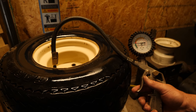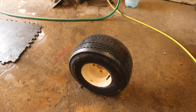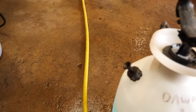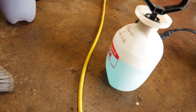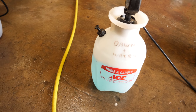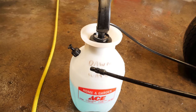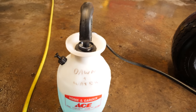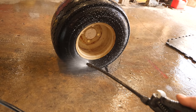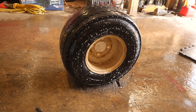We're just a hair over 40. Once we get it filled up, I bring it back over to where I washed it. Then I take a one-gallon pump sprayer — I have a whole bunch of them. One has Super Clean; this one has just Dawn dish detergent and water, no specific measurements, just squirt it in. I'll take this stuff because it foams up really nice and spray it on one side of the tire and watch for bubbles.